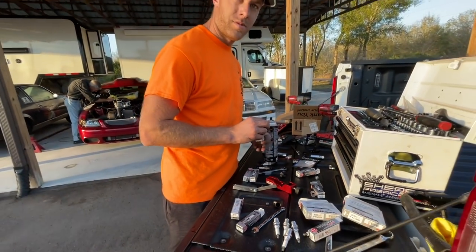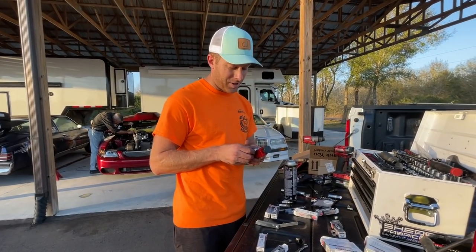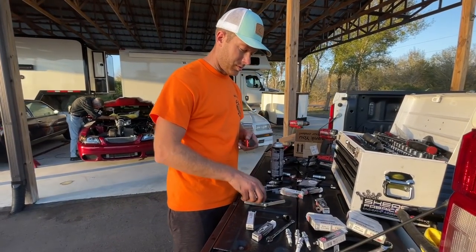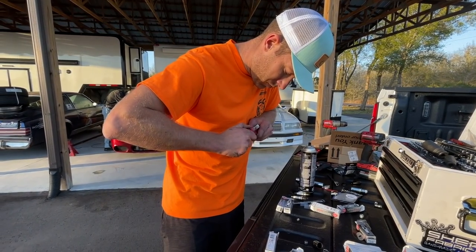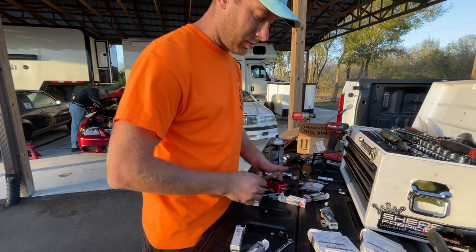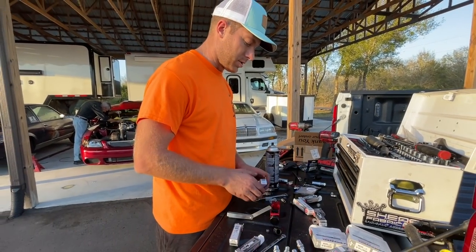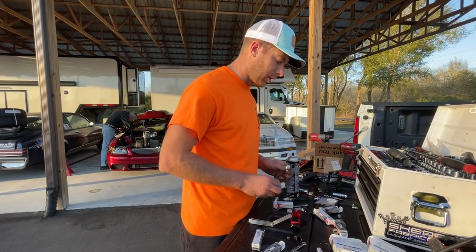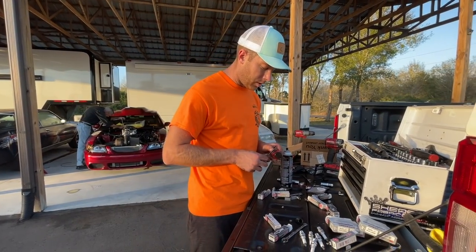I am the guy that taps it on the vise in the shop — we've all done it. Get one of these. Brent had one on race week once and I was like, dude, that thing's the way to go. Especially just putting the feeler gauge right in there and tightening it down a little bit. Makes it a lot more simple, cleaner, easier — you're applying even pressure across the plug, you don't bend it one particular way or the other.